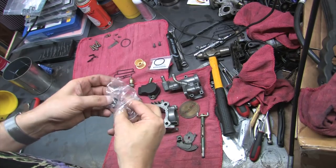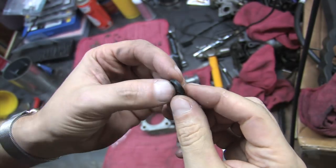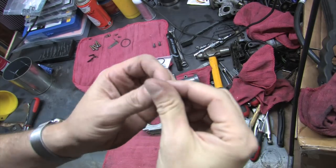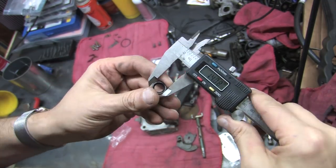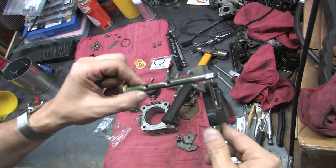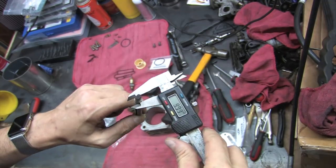People have gotten away from supplying mil-spec seals for the most part. This seal has a metal insert, but it's completely coated in rubber, so it's very stiff. I don't know if it'll come through in the video after export, but there are ribs on this thing to help it stay put. You can see when it's measured that they make it a little bit bigger than the 14mm hole. On a new healthy seal, the inner lip of the seal measures almost a millimeter smaller than the throttle shaft. That little squeeze is what does all the work to hold your boost in, and that's why crusty old hardened seals leak.